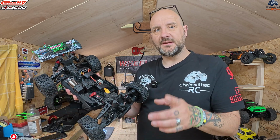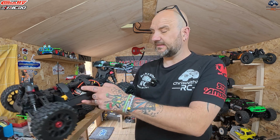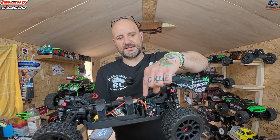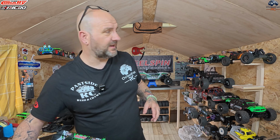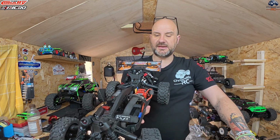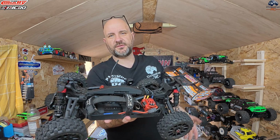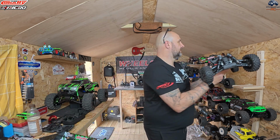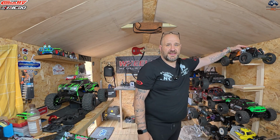The only issue I have had, and I will say with experience, is this battery tray. In the past, I have had one break. There's a little adapter here. When you put your battery pack in, if I've had an impact, this little adapter here has snapped. There are aftermarket battery trays which you can get for these. My friend at Garage Life, let me just show you quickly. He does make them. Makes a really nice 3D printed battery tray there, guys. Should you want to further down the line, it basically fixes your battery in a lot better. But again, you might not even need that. Me personally, I added it, and I've not had an issue since.